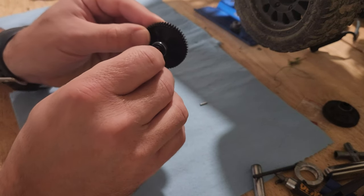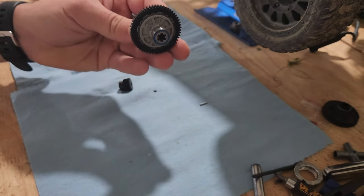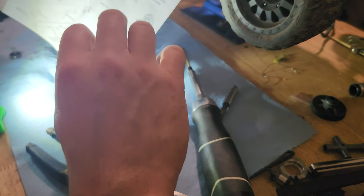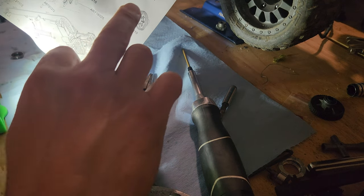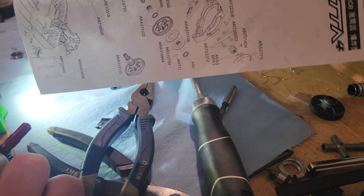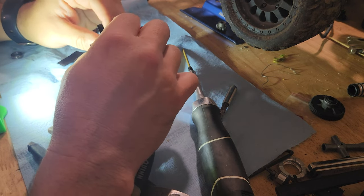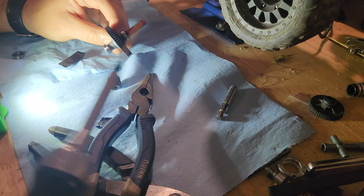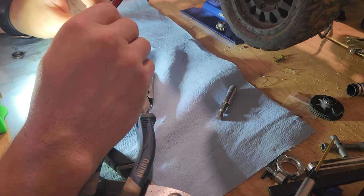The next step is you're going to yank this piece all the way through the hole. Now, there's a pin right over here — you can see it in the far back — that should be like step number two. I call it the 'oh sh*t pin' because if you misplace that pin, you will not be able to put this clutch in there. If you don't put that pin in, this clutch isn't going to work.